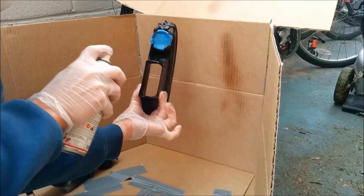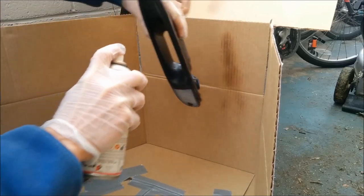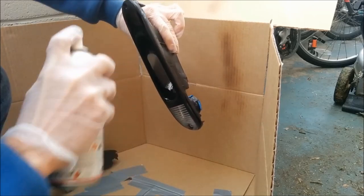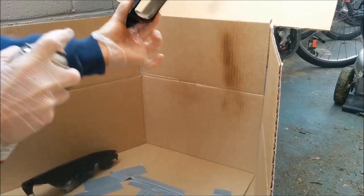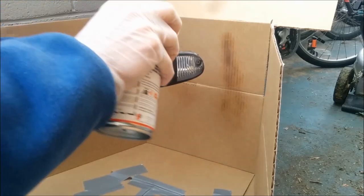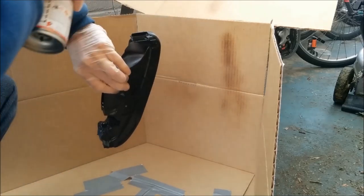Once I had the whole light wet sanded, I used the two-part clear coat. Since it's a two-part clear in a can, you have to activate the hardener first by pressing a button on the bottom of the can. This activates the hardener, and then you have 48 hours to use up the paint before it goes bad. This paint is fantastic and provides a much more durable finish than the cheap Dupli-Color clear coat. Since it's going to be susceptible to rock chips being on the front of the car, this is absolutely necessary to avoid paint chips.